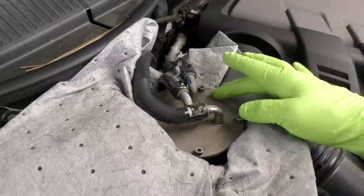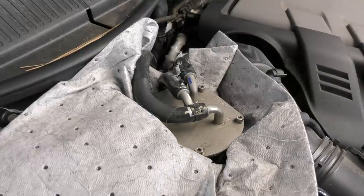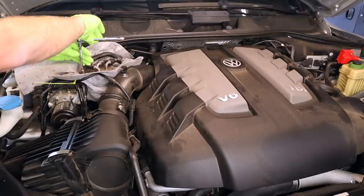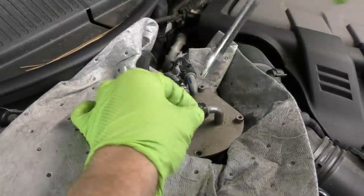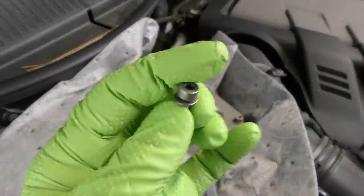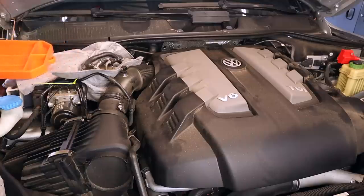Next, we're going to remove the five bolts that hold on the lid for the housing. You're going to need a T20 Torx for this. We're working with diesel fuel, not gasoline, so you can use power tools here, but these housings and everything are pretty soft, so I typically just prefer to use hand tools. As you can see, these bolts are pretty small too, so be careful with these — we don't want to lose one. We'll just go ahead and set them in a tray right there.